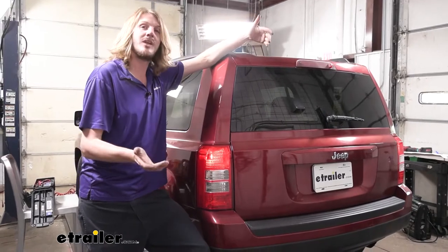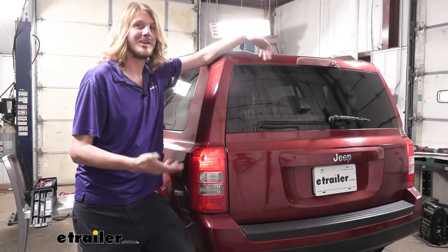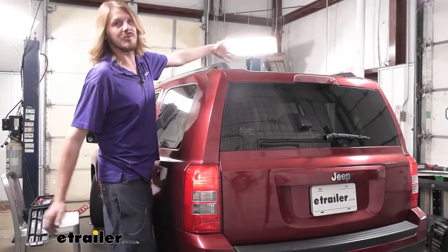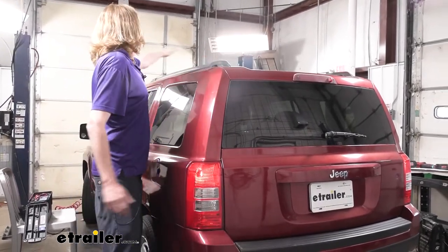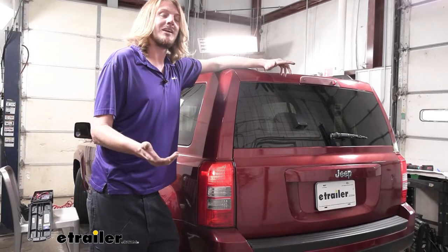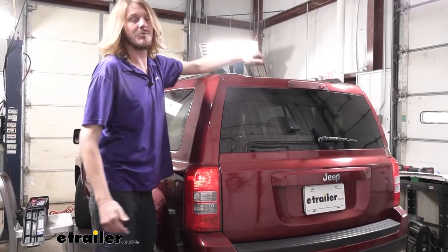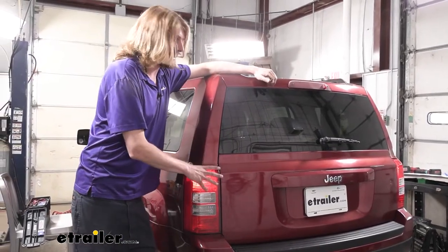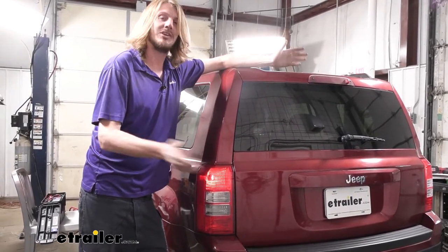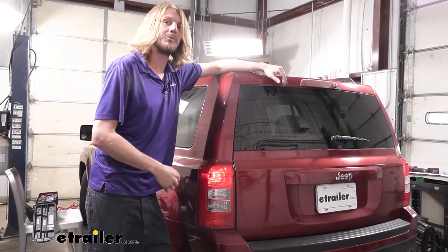The other option is magnetic lights, and I do like the magnetic lights — they're great, especially if you have a portable braking system and multiple vehicles you flat tow. But if you just have one vehicle, they can be a little cumbersome. With those lights, they just adhere to the top of the vehicle, and you do have to run the wire to those every time up to the front of the vehicle so you can plug into your motorhome. It is possible that over time, while they have a scratch resistant pad on bottom, that pad can wear out and you can get abrasions on the vehicle. With the setup here, it's all hidden throughout the vehicle, has a nice connector up at the front that we just plug into our motorhome and everything's good to go. There's almost no work involved with hooking up for the flat tow other than plugging in the connector. It is a little more work up front, but it's worth it in the end.